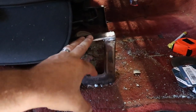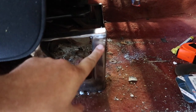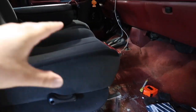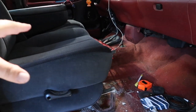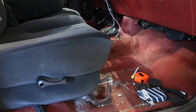Over here on the passenger side, these were the first mounts that I made — these are the factory 1995 mounts. What I did is cut two inches off because these seats actually sit too high in the truck. Now you can see it's not exactly sitting where it's going to be, but you do have nice headroom and a nice seating position when mocked up on these mounts.